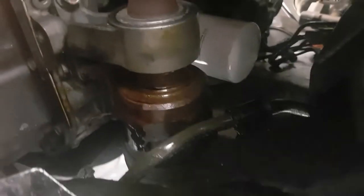It's still dripping from the old oil because the old oil dripped everywhere — Honda geniuses. That's a pretty good seal right there, perfect. Now we're up to final checks. Underneath you want to check that the oil filter is tightened on properly, the sump plug is tightened on properly, and that little trap door is put back on.